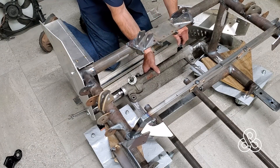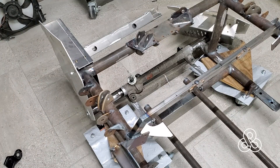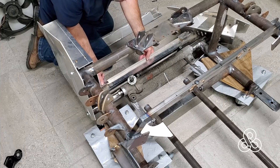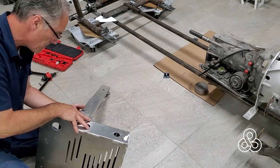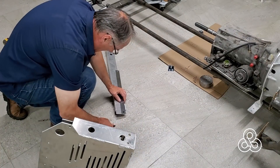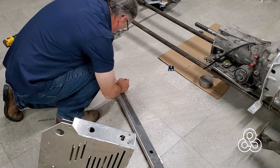To make sure of a fit, we're going to throw the steering rack back on because we want to push this lower brace right up against it — not right against it, we want a little clearance, but as close as we can get it. So I'm going to try it in place and put a couple of marks on it, then pull the whole crash structure off and bring it out so I can have access to it and put some rivet nuts in and drill holes to mount the whole thing together.